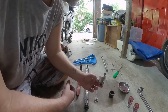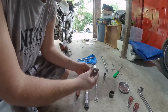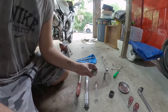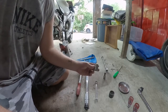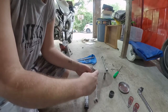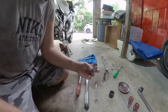And this is the special tool that I made. It looks pretty ghetto, but it works. To get those lock nuts loose, I used a one-and-an-eighth Craftsman 12-point socket. I was going to take them off, didn't have the tool. So what I did was take this socket, put it in a vice, take the grinder and just cut downward just a little ways, then one around, same on both sides. Knocked those pieces off, and then I got the two prongs where I can get that lock nut on and off. And it works.